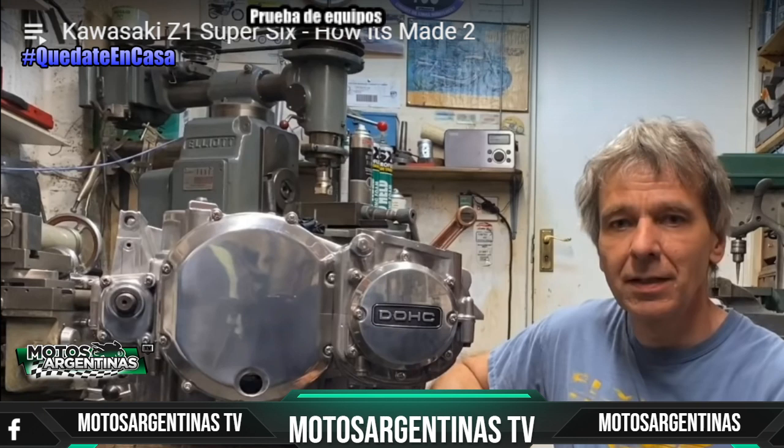With the holes drilled, I trial fitted the cover back onto the engine and the screws went in lovely. With the cover finished, it was time to go back out into the garden in the bright afternoon sunshine and do some polishing. But before I can buff the stainless steel on my buffer, I need to rub it up with some 320, 400, 600 and 1000 grade wet and dry paper. With that done, straight back into my shed onto my old buffer and give it a good shine.